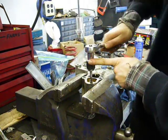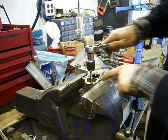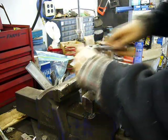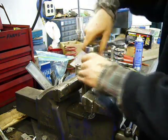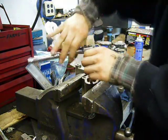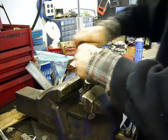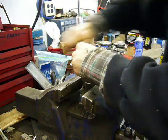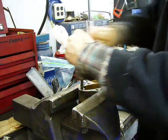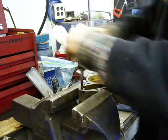One oddity about using a newer water pump housing on an older engine is that the older engines don't have this stud on the block. So this hole ends up going into the water jacket. To solve that issue, I'm tapping this side for 1/8 inch NPT, and then I'll put a pipe plug in it and some epoxy over the hole. Then the other side needs to be tapped for a bolt to secure the water pump, and I'll tap that for like M10 or something. And this side I'm tapping for M10 by 1.25 because this hole is needed to bolt the water pump down